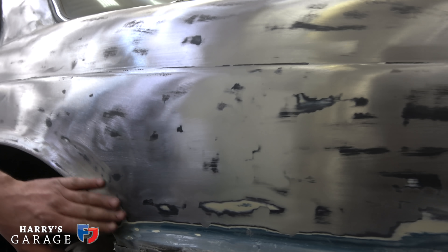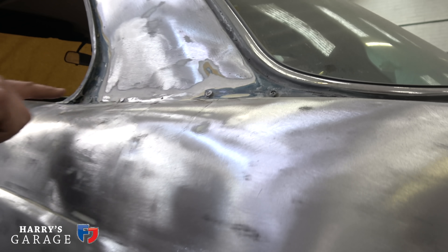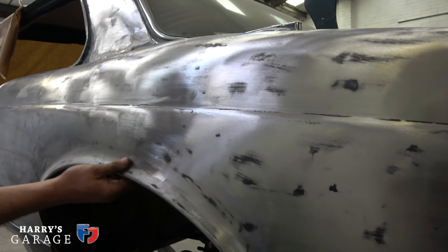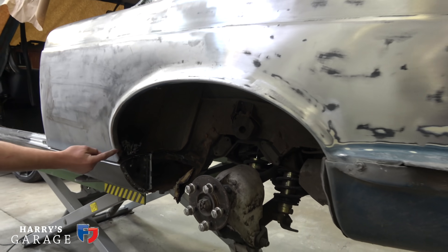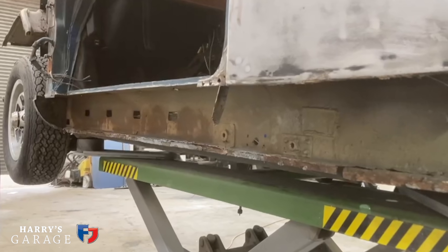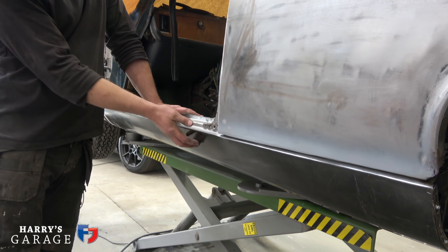Better news on the other side — a lovely unblemished panel. Of course it can't be original. Looking up here, there's a welded join across the top where it's had a quarter panel fitted at some point. The factory join is underneath the lead work, but they've done a lovely job fitting it, fitting nicely all the way around with no obvious signs until you get the paint off. On this side we've pushed forward — had the outer sill off, the inner sill was nice, with a repair at the back that wasn't meeting correctly, so we cut that out and made good.